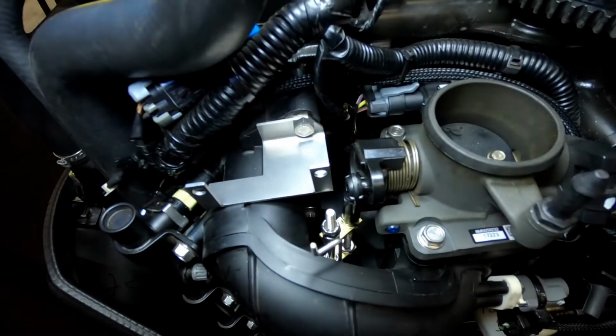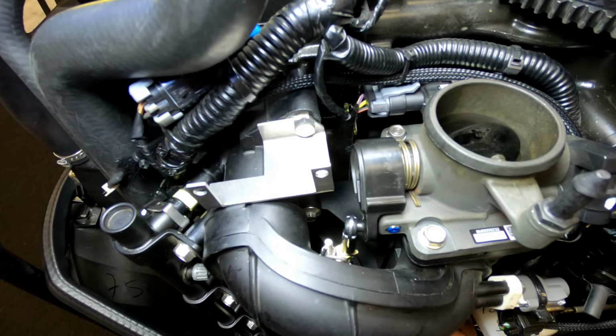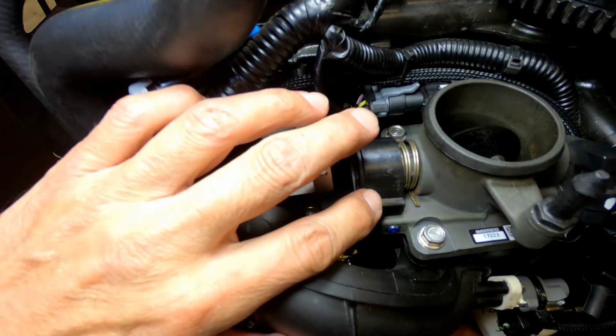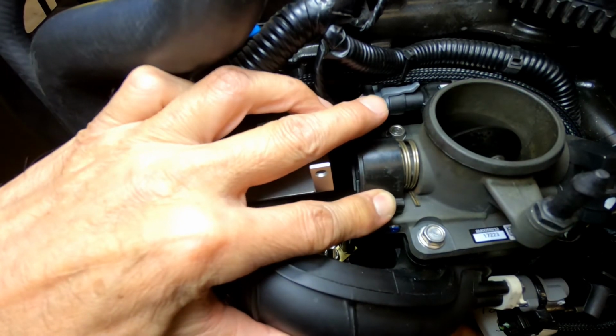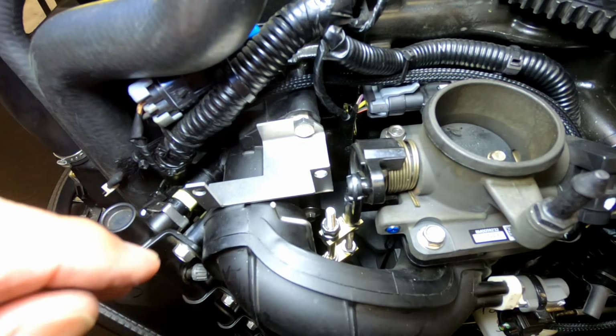That looks pretty good, but there's a test. The test is to go to the bottom of the motor and operate the throttle rod of the motor. We disconnected this earlier in the installation. I want to see if there's just a little bit of play here. It's a little too much, so I'm going to tighten the nut a hair more.